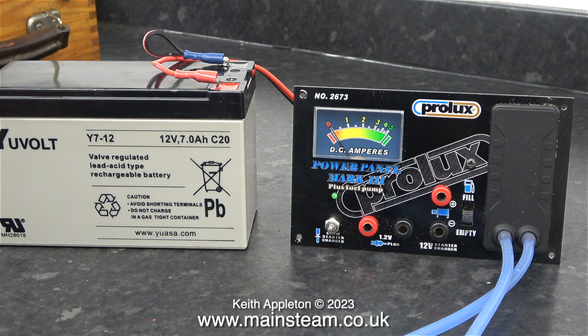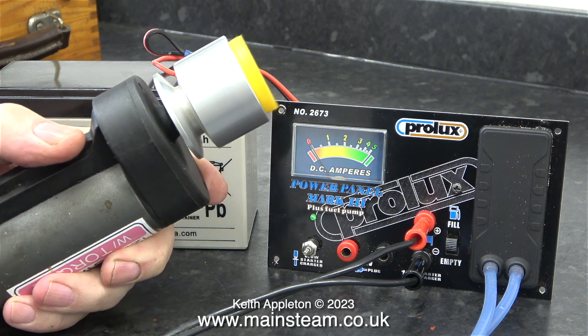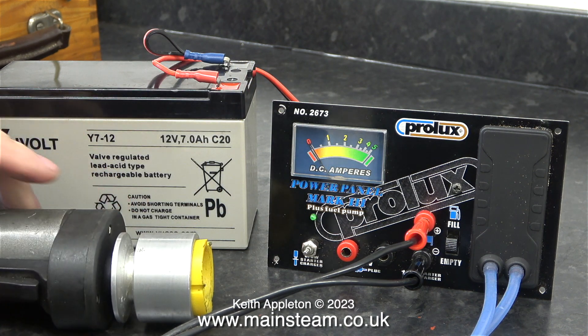You may be thinking: when it's all together in the box, how do I charge it? That's quite simple — I plug the battery charger into the positive and negative outlets that power the starter motor, because these connections go directly to the battery.